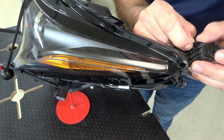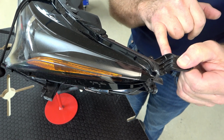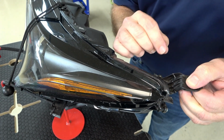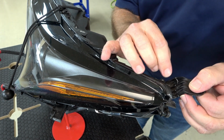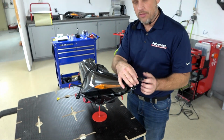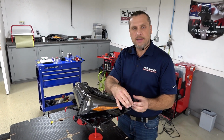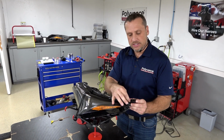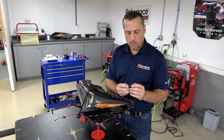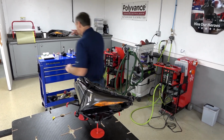Right on. Nicely. So what we're going to do is apply a couple of staples in both sides of this tab to hold it in position. And then we'll mix up some Tab Magic putty and apply it in these grooves so that when we weld the back side of this tab, we want to weld as deep as possible. That Tab Magic putty is going to prevent these little louvers from distorting or folding over. So I'll go ahead and grab the stapler and attach that tab.